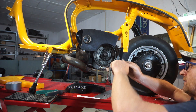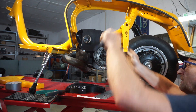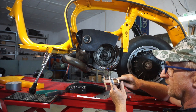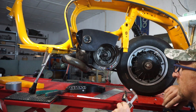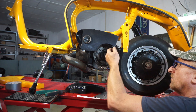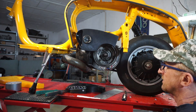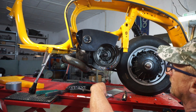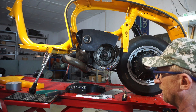Let's get around the back here and take a measurement. We're looking at 50mm from the airbox to the back of the mag housing, so we want two brackets 50mm long and then with an L on the end.